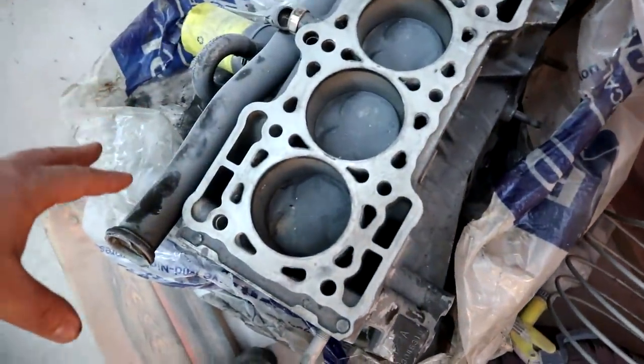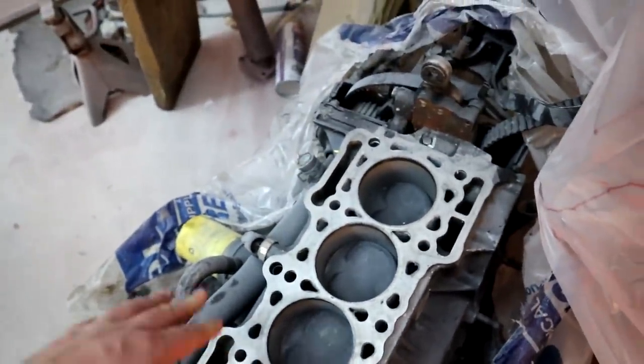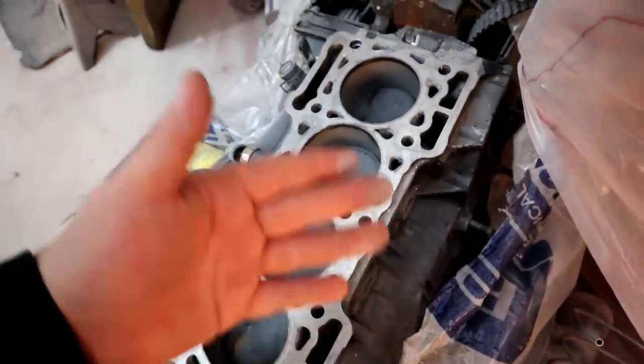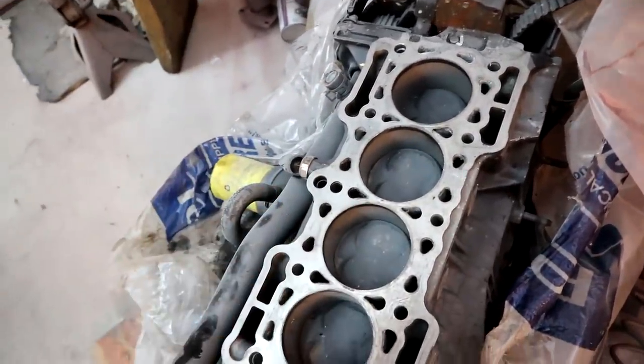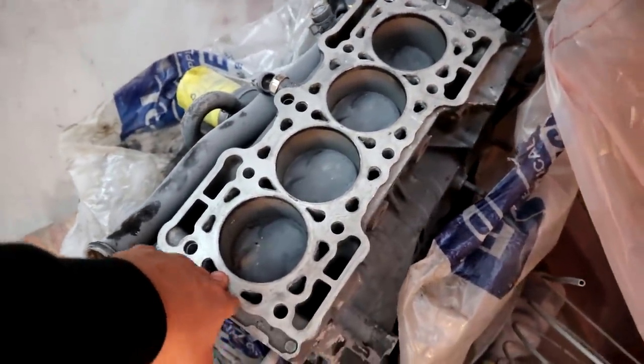There's all the info if anyone wants to chime in. As you know, they are an FRM block, but it's closed deck, so no need for a block guard — obviously you couldn't put one on. The only weakness is the FRM sleeves, which actually are a strong point because they keep friction down. Porsches use them, some performance cars use them. But their compatibility with forged pistons is very limited in what you can do. The rods aren't, which brings me to this.